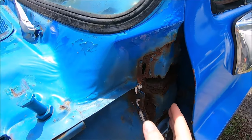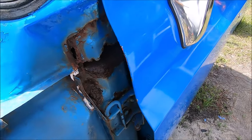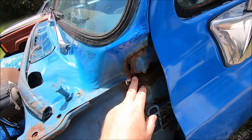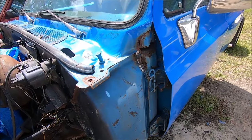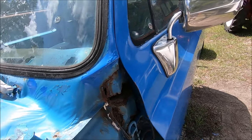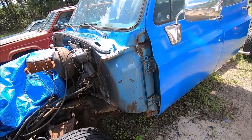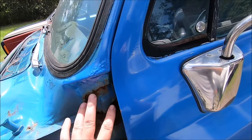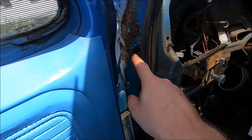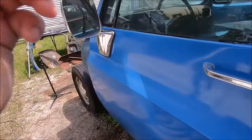The bolt points are missing — when I took them off they ripped out. We have to get that screw out and maybe reuse that threaded insert, and down there the bolt ripped out too. We can rebuild that. What I'm going to do is duplicate this one — this is easy enough because I can trace it. Up here is going to be a little more difficult because it's angled in; there's kind of a compound angle thing going on. We're going to try to reproduce that as best we can. The main thing is going to be getting that hole and welded nut in the right location.